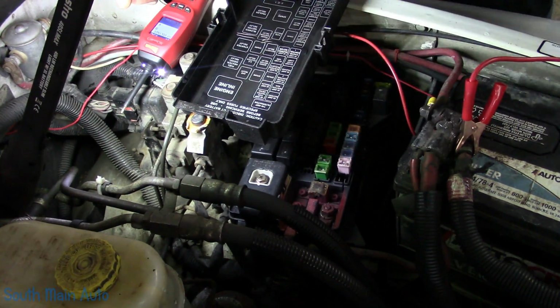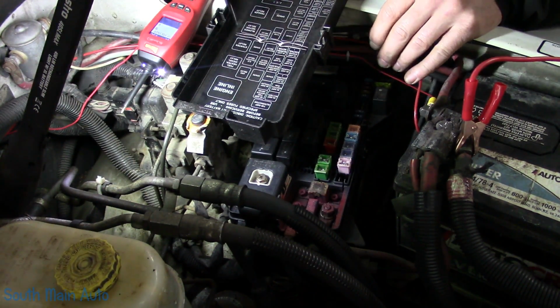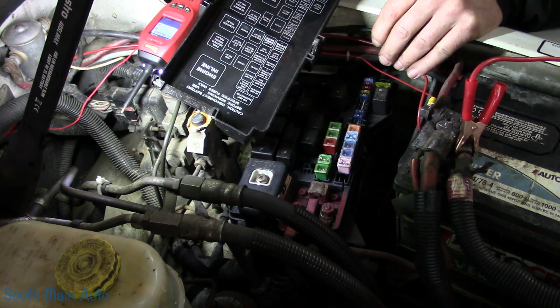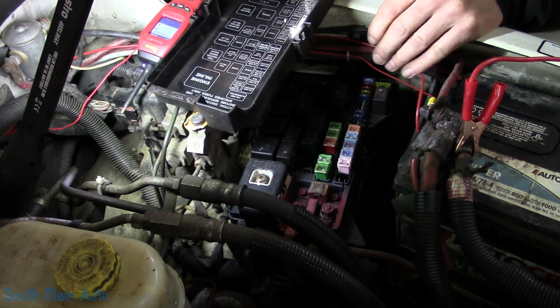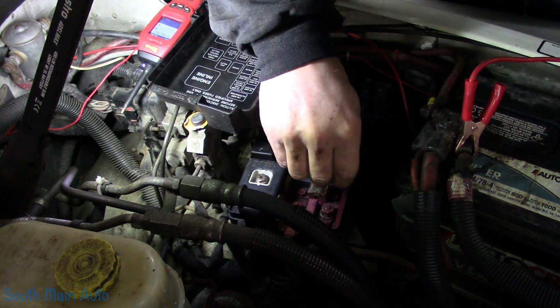Let me see if I have one of these J-case fuses in a 50 amp. That's super bizarre. Just the general fact that I mentioned in the beginning of the video, don't just check the fuses visually, because one could be missing. Alright, well, that's the first piece of the puzzle anyways. Got us a brand new 50 amper.